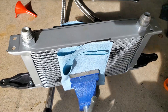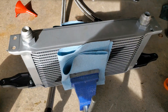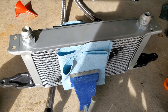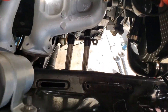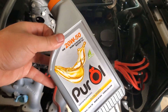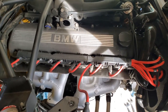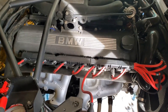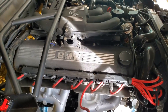That took a little more than half a quart of oil. I'm putting the lines back on and starting to fill from the other side where they hook up to the sandwich plate. Now that everything's tight, I'm adding more 20W50 Pure oil into the engine. I'll crank it over with the fuel pump fuse removed so it can just circulate, then keep checking the oil level.